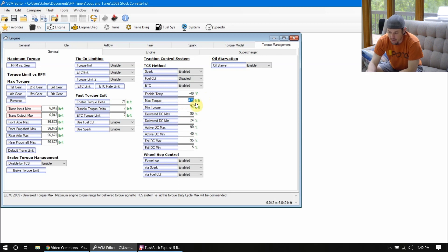If you've got a blower, turbocharger, or something on there and you think you're making 650 foot-pounds of torque, start at 650 foot-pounds of torque, see how things react, then dial it back a little bit. You will know when you are getting into traction control — you will see the light flashing on your dash whenever it is enabled. If you have traction control disabled, this will be bypassed. This is not like Stabilitrack, where it kicks back on at 35 or 40 miles per hour.